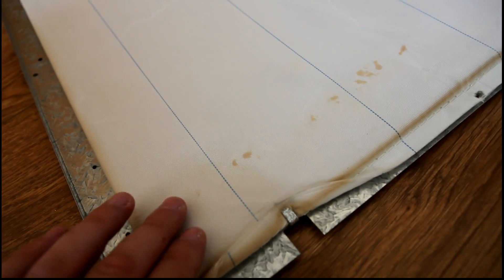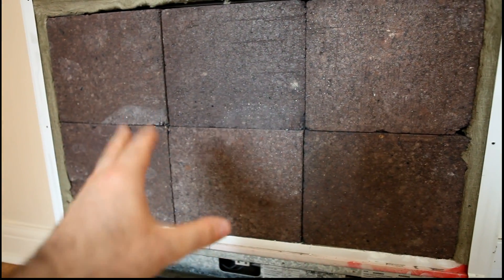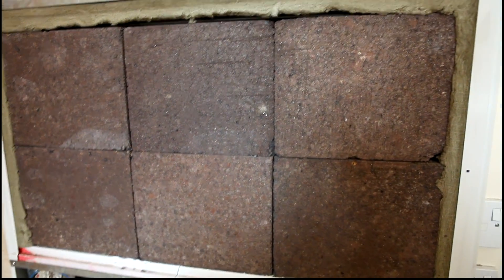So that's the cover off. You can see there's this white mat on top - it's a sort of fiberglass mat with a material inside, about eight or nine millimetres thick. The content is silicaceous aerogel, which is an extremely effective and light insulating agent, used to keep the heat into the heater after it's been charged. The actual heater itself is filled with bricks - there's a total of 12 iron oxide bricks in here.